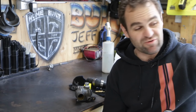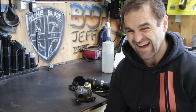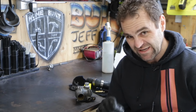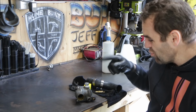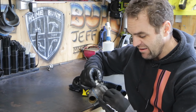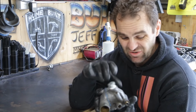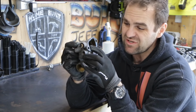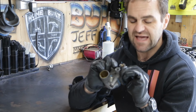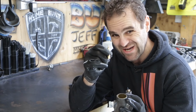Okay, so the original oil pressure sender on this car didn't appear to work, so I managed to get another one off of another wrecked engine. It's an old one, apparently hard to track down the original one, so I'm going to see if that one will work, and I've just made sure the wiring connection and everything is good, so that is easy. The more difficult one is the temperature sensor. I tried to get it out while it was in the car, and I know the guys who are dyno-ing my car mentioned that you're not going to get it out while the housing's on. It pokes all the way through into the inside and it looks like it's sort of semi-corroded in there. I'm going to now try and somehow get this out and swap it over for a new one. And then fingers crossed my temperature gauge works.